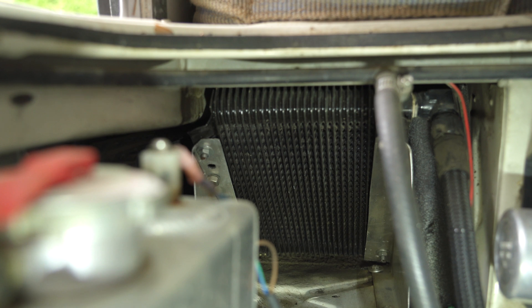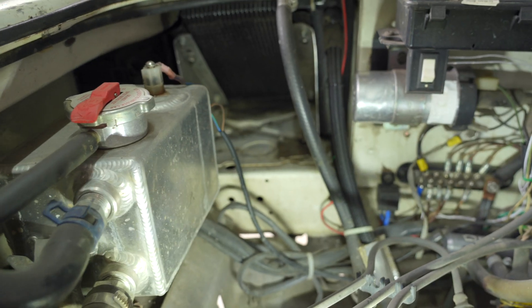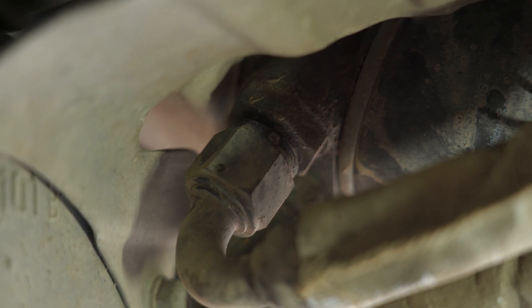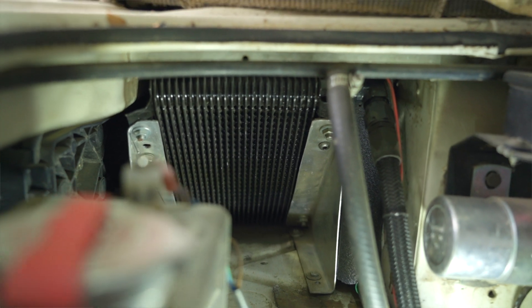I like to do my stuff myself, so I decided to make my own kit. I sourced a 10-row oil cooler — I'll put it in the description — and I'm putting it all on the driver's side. We did AN fittings, a sandwich adapter, and fittings that go from the sandwich adapter up to the oil cooler. On the back of the oil cooler I've got a Spal fan on a switch. I was going to put on a thermostat, but I like to be able to control it — kick that fan on before we go up a long hill climb so I can be proactive and keep those temperatures at 220 or so. I did fabricate the bracket to hold the oil cooler, and what you're really trying to do is put it in this area so all the air from this vent has to pass through it as it goes back down the engine.